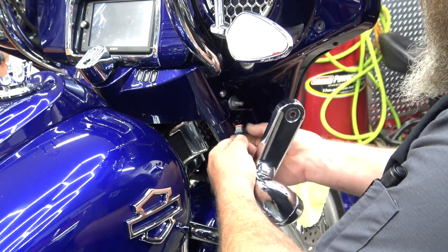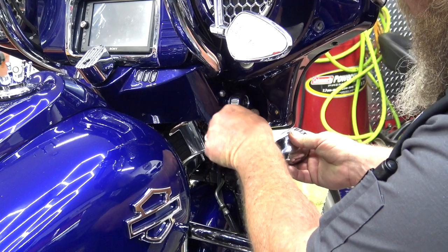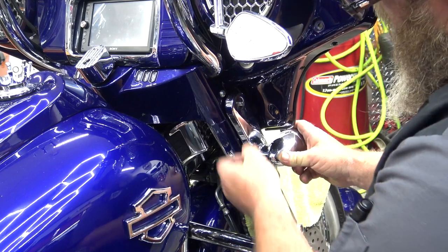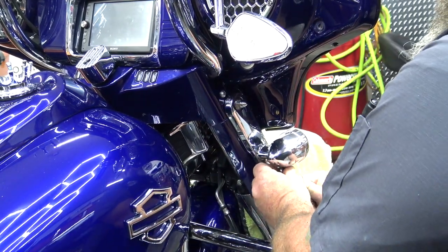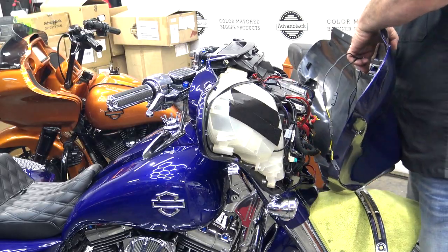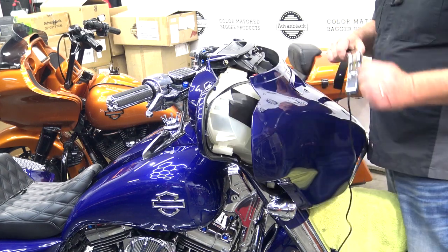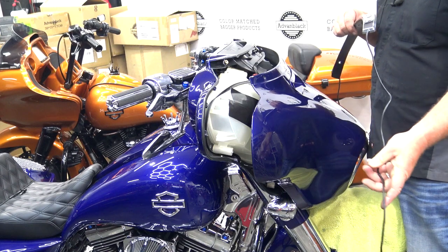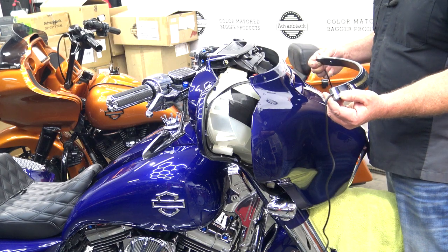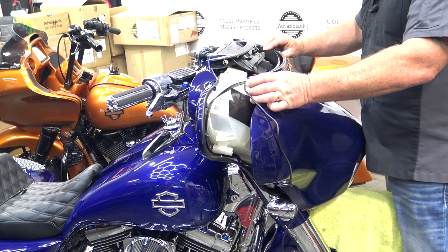Push the splitter through so we have it on the inside of the fairing with the outside sticking out for our turn signal. At this point we can reinstall our turn signal. When you're putting this back on, make sure that you're not pinching any of the wires front and rear when you put your acorn nuts back on. Do that to both sides of the bike. From here, we can set our fairing back into place and plug in any lights that you unplugged previously. Also undo the wires on your trim — make sure the wire is coming out the side, through the slot in the rubber and the slot in the metal, without pinching anything.